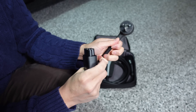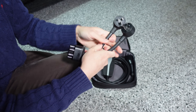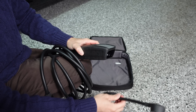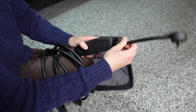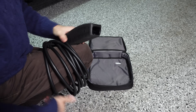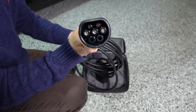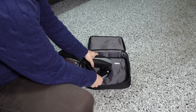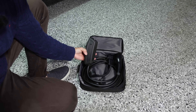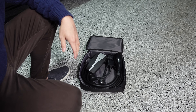If you've got access to a 15 amp socket, the UMC might give you a slightly faster charge rate. The charging box plugs in either the 8 amp or 12 amp tail on one end, and has a Type 2 connection on the other end for the Tesla Model 3, Model Y, Model S, or Model X. To change the current there are no physical switches — you have to use the car's infotainment UI.